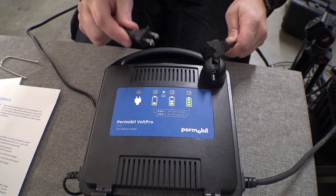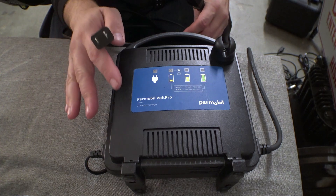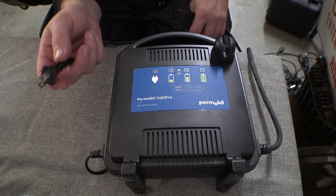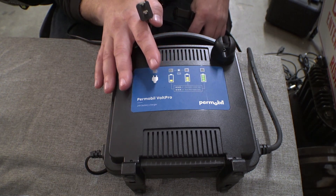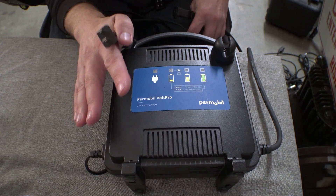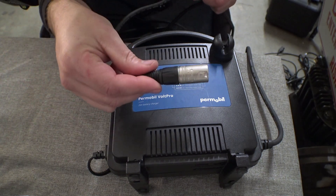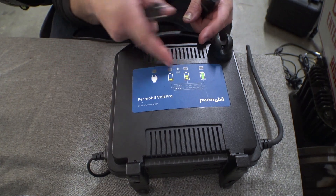What it has to do with is when you first connect this charger to power. We've got four lights across here. Like most people, I leave this charger plugged into the wall all the time. The manual always says to plug your chair into the charger first and then plug the charger into the wall, and reverse when unhooking. In my opinion, that is not necessary — nobody does that. They tried to blame that improper use was causing the melting joystick port issues, but that is not the case. I simply leave this connected to the mains and only touch the cable end when I plug it into my chair at night and unplug it in the morning. It's probably confusing what they mean with the flashes because I never unplug this and never see it blink.